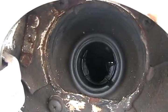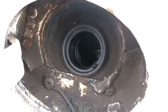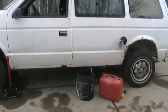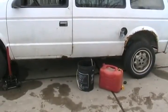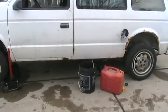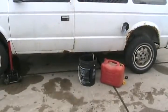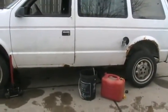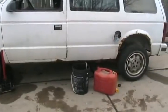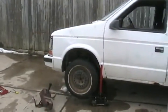The big chunks of plastic fell in the tank but they're too big to get sucked up, so who cares. The gas tanks on Chrysler vehicles have one extra tube coming out of the top with just a rubber cap on the end that goes nowhere — that's your fuel drain tube. In case you have to remove the tank, you start sucking on it, add a hose, and it siphons itself out. When running a diesel conversion, you don't need the fuel pump in the tank — diesels suck their own fuel through the injector pump. So that extra drain tube is now hooked up as my input fuel line to the engine.